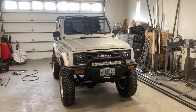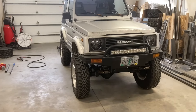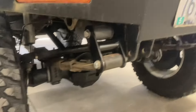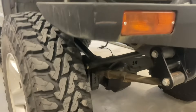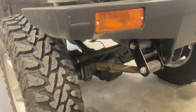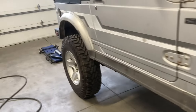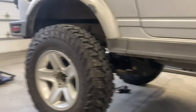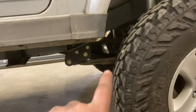Going back to work on this Samurai. Today I'm doing a little suspension work. Like I mentioned before, this is on Jeep YJ leaf springs — just regular conventional shackles, no missing links. These are OEM Jeep springs, so they're old and got miles on them, nice and broken in. I built all the brackets for the front, the shackle hangers and shackles. This is a Sky Manufacturing rear kit — four leaf pack in the back and five leaf in the front.